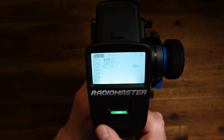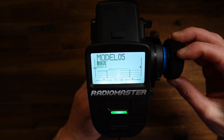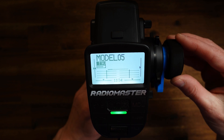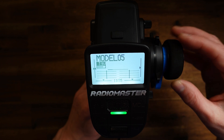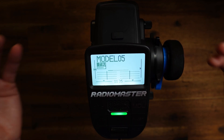Now let's see in the monitor what we have. The switch is now in the outward position — front wheel steering only, normal operation on channel 1. I bring the switch now to the middle position. Now channel 3 follows channel 1. This should be four wheel steering because in the middle position we would like to have four wheel steering.